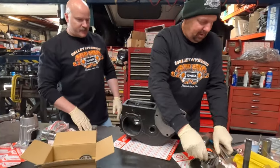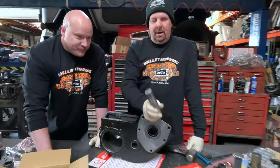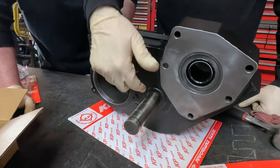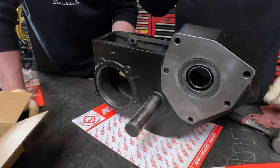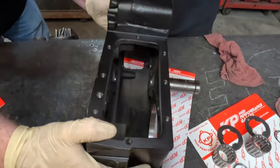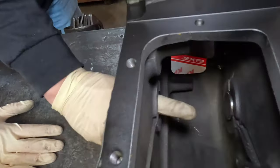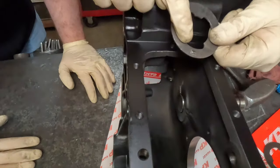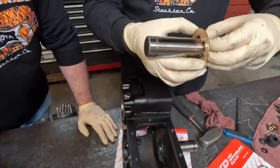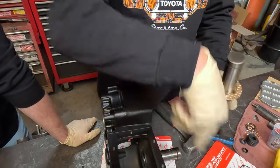You have to maneuver it carefully because you don't want to cut the O-rings. I took an old idler shaft and ground it down a little bit to use as a guide on one side. You can also use a socket that's a slightly looser fit. I bring the guide in just a tiny bit because this washer needs to be in there — one on each side. You can see the slot inside the case; the washer has a little tab that goes against the sidewall and into that slot to keep it from twisting. It's supposed to be stationary. It's got little dimples for oiling holes so there's always a layer of oil in here, and then the gear kind of spins on the washer and the shaft. Then I put a tiny bit of grease on there to hold it in place while we drop the gear in.